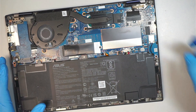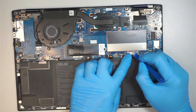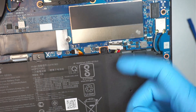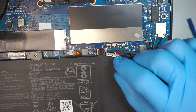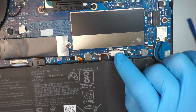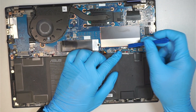There you go. Once you have removed the back cover, you can see the internal part of your laptop. The first thing you notice is this metal piece — that is your battery connector. What you want to do is push that metal away from the connector so the battery connector can be removed by gently lifting it up. This metal piece is a lock that locks it down; you need to push it away — you'll hear a little click. That metal part has to be above the white connector, meaning it's open, and now you can remove the connector. A lot of people don't pay attention to this and try to yank it out, eventually yanking out the entire connector — that means you just broke your motherboard. Don't do that.